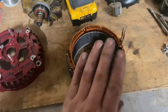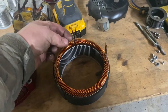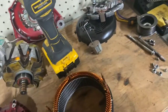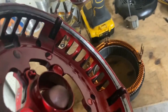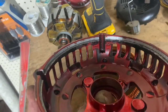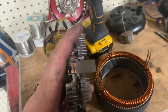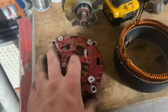I've made a couple videos already — one on how the taps are made to create this 370, and one on the rectifier dual stud assembly. So I'm going to start assembling this one. This is the rear housing. You'll see that I've ground down the edge going all the way around. The ground for the alternator itself runs through here, and the hot comes through the other side, which bolts directly to this case.